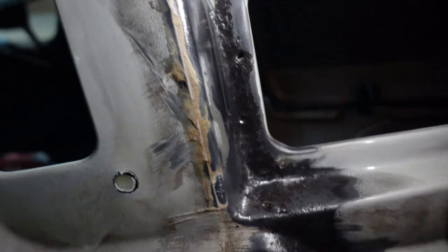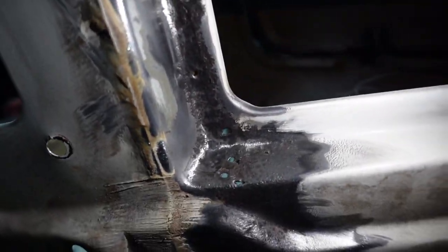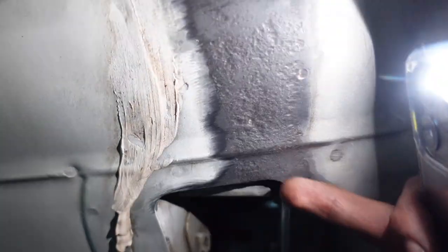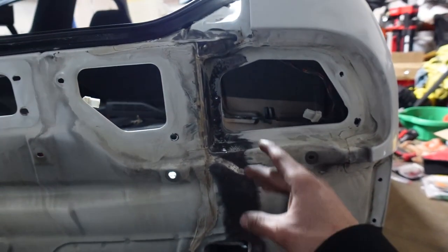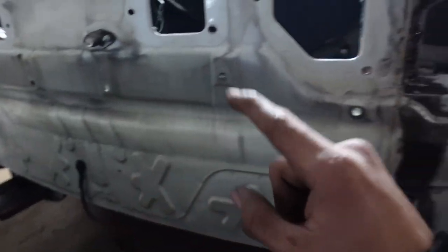I hit everything with the dremel and the big wire wheel — my ears are ringing. The little dremel put in work though. The sandpaper cone spins really fast but it's so small I can only hit a small area at a time. It worked really good for the corners, and then I used the big wire wheel for another pass. It came out pretty good — not perfect, but good enough for paint. I'm gonna put some more rust gel all over this, let it sit 10-15 minutes, and hopefully that takes off the remaining surface rust in the dimples. Then wipe it off, tape it off, paint it, and put everything back together. Wear ear protection and goggles when you're wire wheeling — the little wires break off the wheel and I got one in my eye once. I wouldn't wish that on my worst enemy.